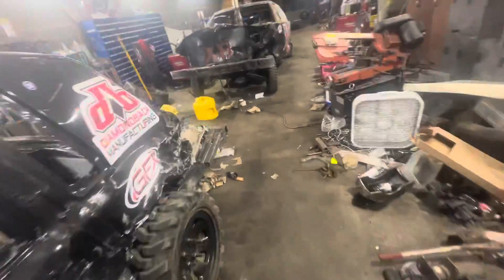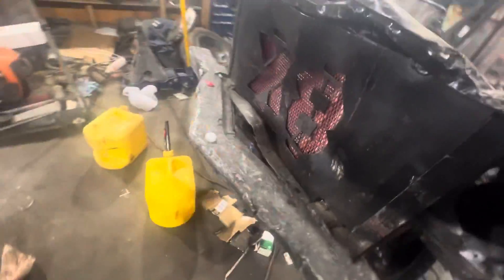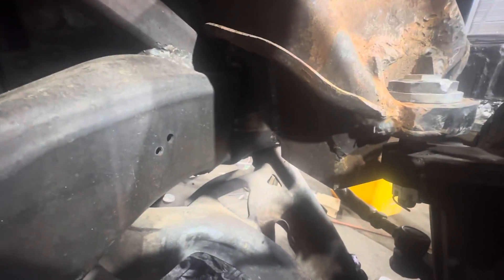We'll show you my dad's car — it did end up moving quite a bit. He smoked the K-rail like four times because he lost brakes as well. So this side's not that bad; up front here never moved, but behind the kicker it did kink in. This side is the worst of it — you can kind of see how off-center it is. It ended up pushing back into the spring pocket and kinking back there, which in turn broke the engine cradle, which in turn made side-to-side movement and sheared all the side bolts out.